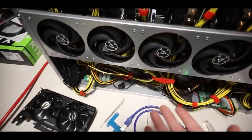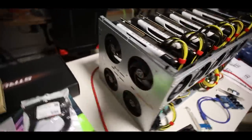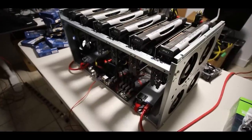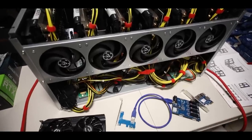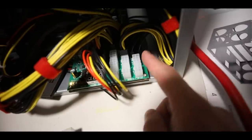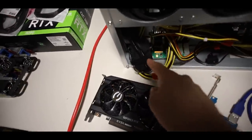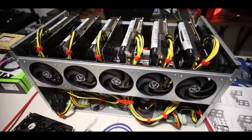Now, the fans obviously require 3-pin power. And so I had 13 fans here. I actually almost added another 5 fans on the other side, as it can take another 5 over here, okay? You guys can see the holes, we can add 5 more. So that would be 18 120 mm fans on this frame, which is just nuts. But the potential issue, which may not be an issue for some, is you'll need to have fan hubs or fan controllers or whatever to power the fans. Luckily, I had a Cooler Master fan controller, and the ZSX board also has a bunch of fan ports on the breakout board. So I have pretty much this half side of the fans going into the breakout board, and then I have this other side of the fans going into this Cooler Master fan controller, which runs on SATA. So I hope that will be enough power to run these fans. We'll see once I turn it on, and all that good stuff.